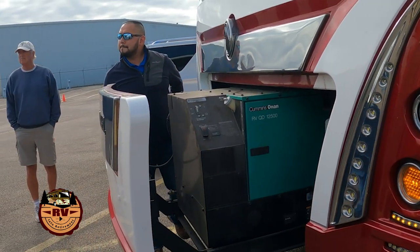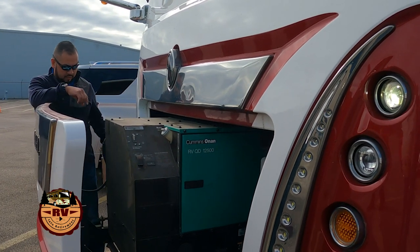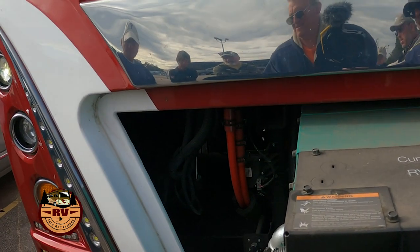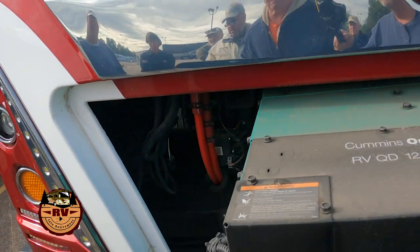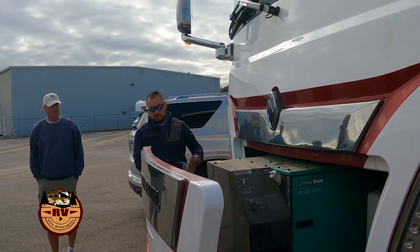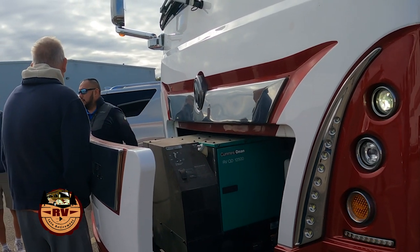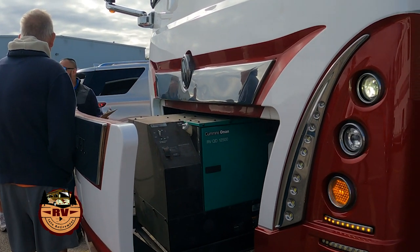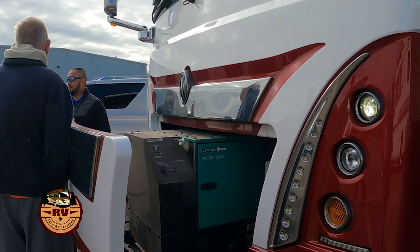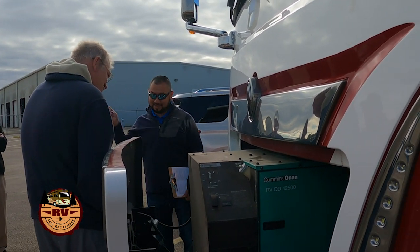Excuse me? Yes. Ronnie Blackman said that if you have a problem with your step coming out, is it a cable under there with the T-handle? Where is that? It's right here. So if you take a look here, this is a release for this particular step, the Braun Executive step. So if you have a Realm, an IH, you're going to have this step here. There's an instruction card on it that tells you what to do. So you'll just turn it to unlock it, pull it, and that releases that step to where you can manually push it in and then you lock it back and it's there. You just want to be careful and remember that when you open that door, that step's not going to be there. So just ask me how I know.